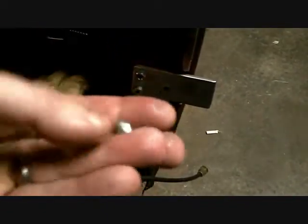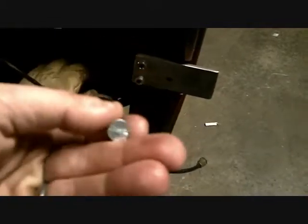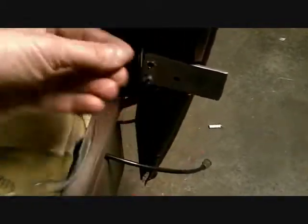A little common sense now: since these holes are quarter-inch in the hinge plates and the holes in the A-pillar are half-inch, what I do is put the taper head bolts on from behind. So when I tighten it down, it centers everything. This hole isn't drilled yet, but it is much nicer to have it closer towards the inside and not right on the edge of the plate, so I'm going to have to drill that soon.